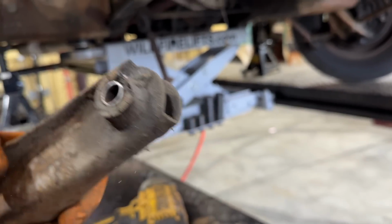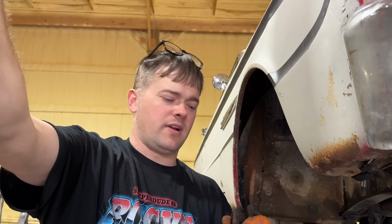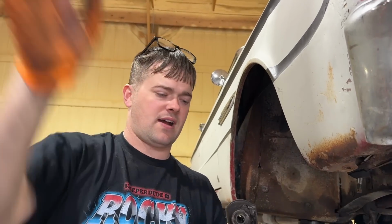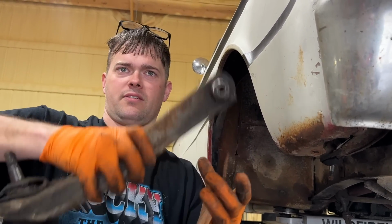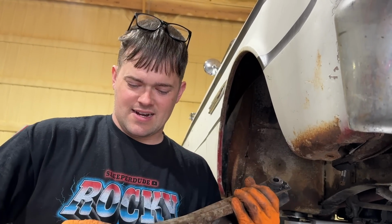That's crazy. When I put the 460 in my Maverick, which is the same exact suspension design, I put a Mustang 2 front end under it. And when I took all the old stuff out, these had a bigger bushing than this, but this, the bushing was just gone. Like you could take the lower control arm and do this. And I was racing it with a 2.3 turbo like that. Wow. What the heck? I never checked it.